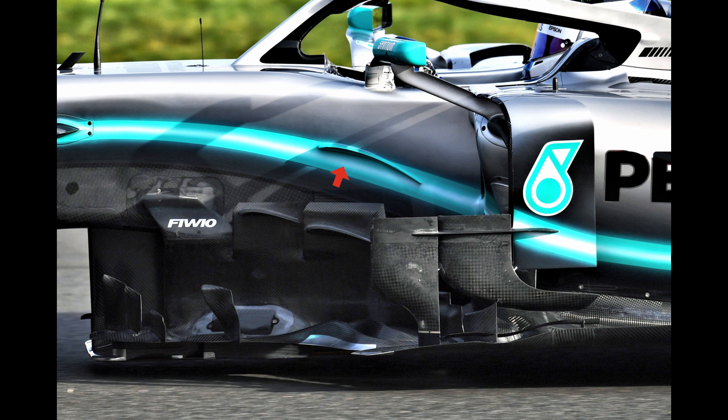A relatively large downwash winglet can be found on the side of the chassis, just steadying the flow in that area and improving how it migrates into and around the side pods. The side pod deflectors are also direct descendants of last season's car, albeit the forward two elements trimmed to suit the new height regulations, and once again I expect more development will be forthcoming in this region, with only their mounting to the side pod really overhauled to suit their shape.